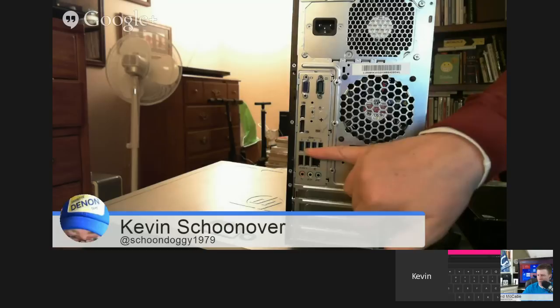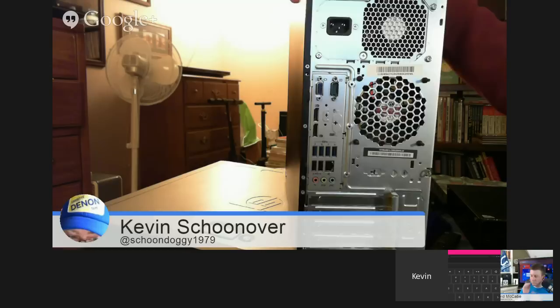So the base unit, you've got lots of USB, high-speed USB. Interesting thing, this guy does have 2 DisplayPorts on it, and we know how some of the folks in the forums like to use their servers as home theater PCs. These DisplayPorts actually pass the audio, so this one does work. The Dell T20 does not pass audio over the DisplayPort. I remember that issue, yep. So another nice feature of this guy.